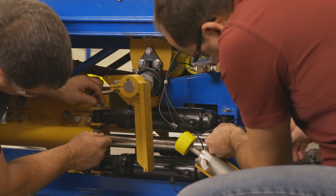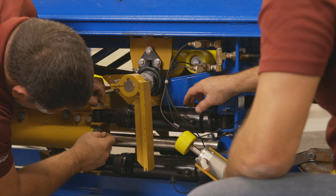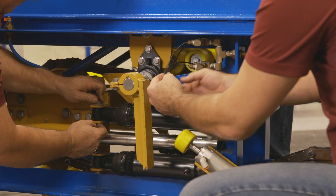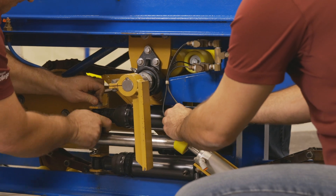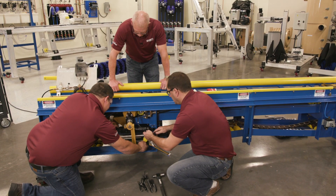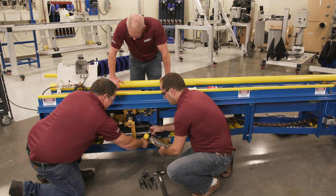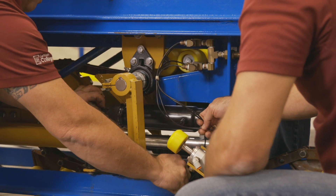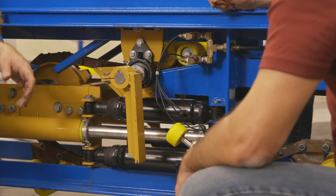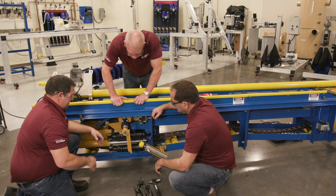Then reinstalling our airlines — make sure you're not crimping those airlines when you're putting them back in — and cutting off your air supply to your shock.